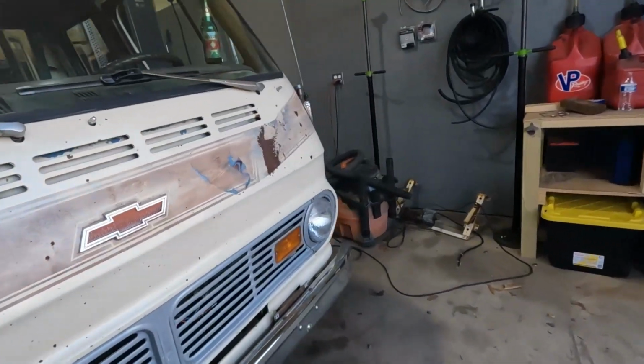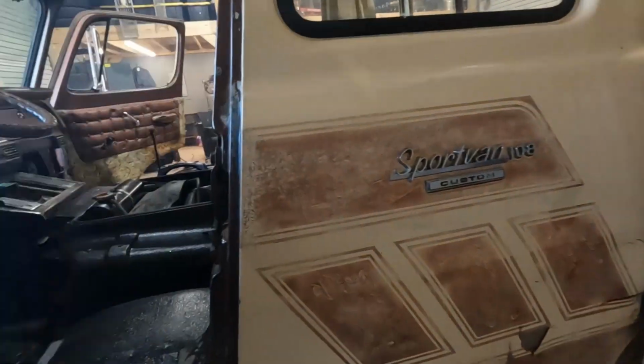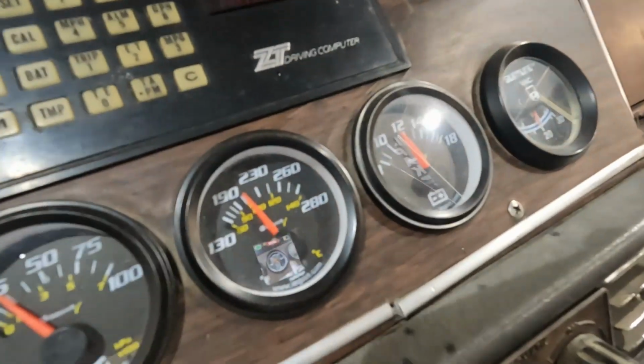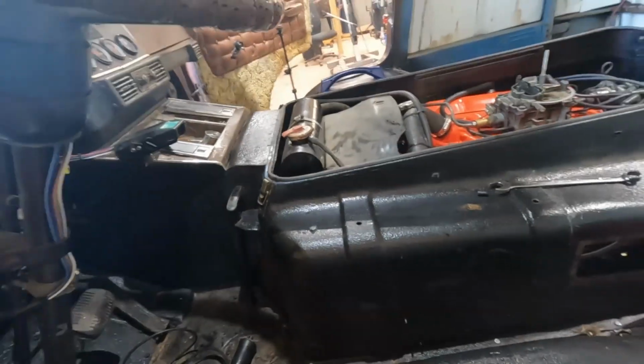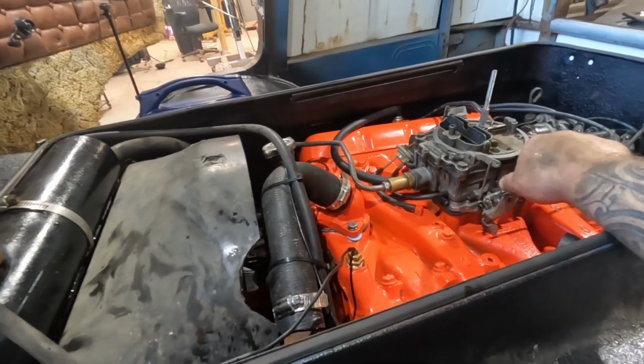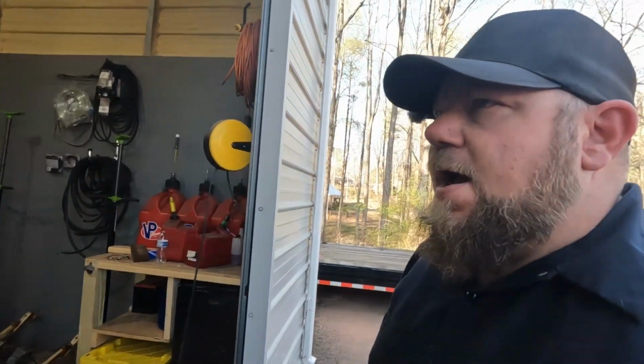All right, I think we're all good now. If I loosen that port now, that coolant temp sensor, I get nothing but fluid. We're sitting right at 190 or so, which is pretty much where it ran before. It does have a 180-degree thermostat. Responding really well. Runs again. I'm extremely happy. Can't wait to take this thing for a drive, put some more miles on it. The actual trip I got to do before didn't end so well.